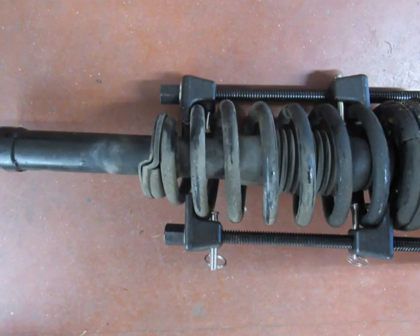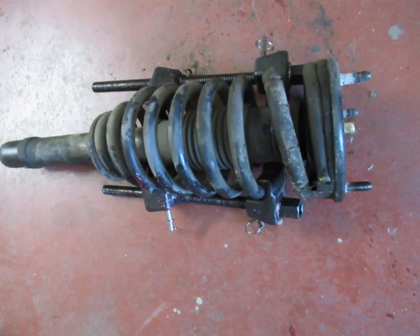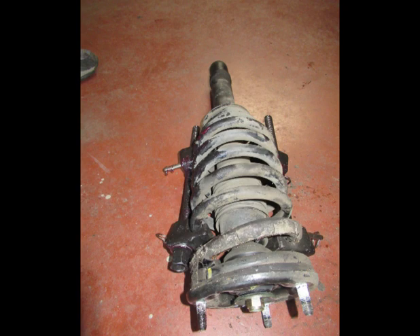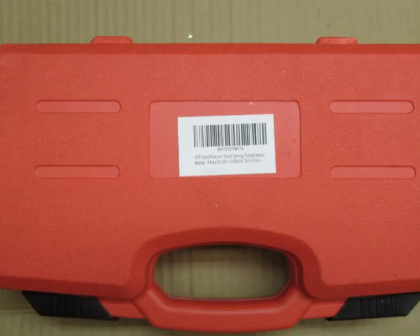I save old hardware — I'll save these springs. I throw the strut away, but I even cut the shaft off this old strut to save it since I can always use hardware. The spring compressor tool from Amazon — thirty dollars in 2023 — worked very well, but I wouldn't want to try to use it on a really heavy spring like a Denali. Keep that tool clean and greased well to make it last.